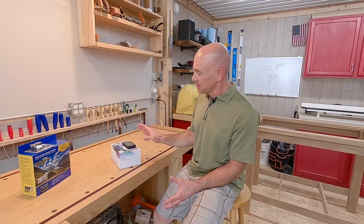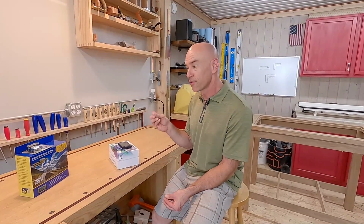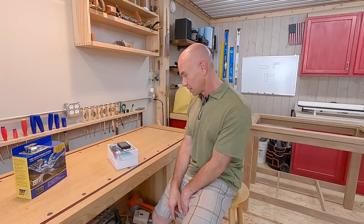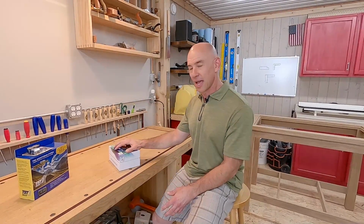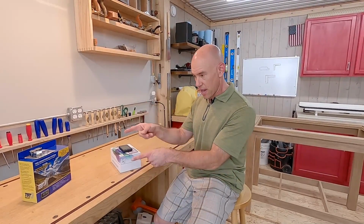And then the final thing is it seemed like we were having problems with our sensors a little too frequently. They're just little plastic things on the wheels, and not always, but we would frequently get a low battery or no battery signal, and most of the time it was a false and spurious warning. So we would just leave it turned off most of the time, and a tire pressure monitor that is turned off is doing you no good at all. Those are the things we didn't like about the TireMinder, although when it worked, it was great and accurate. So now let's see if those are addressed in the TST system.